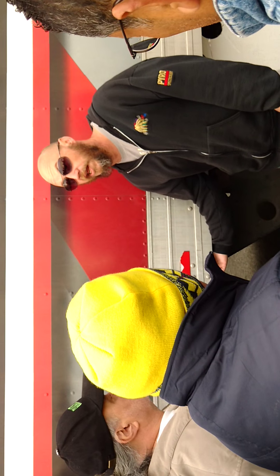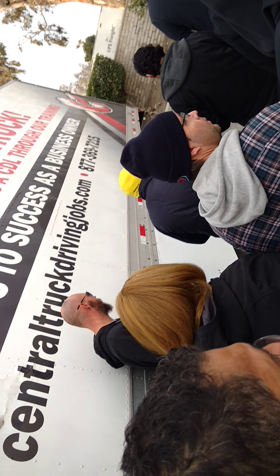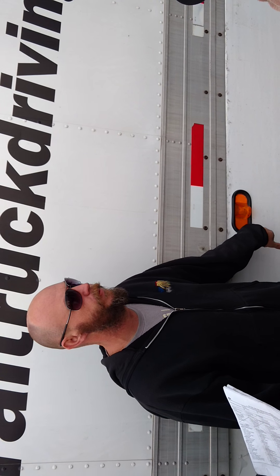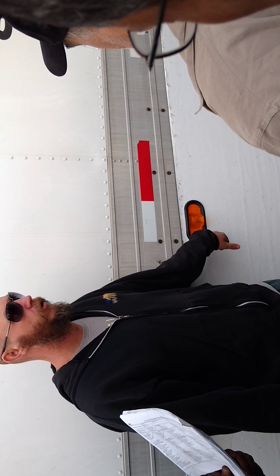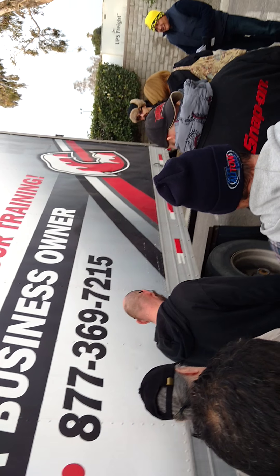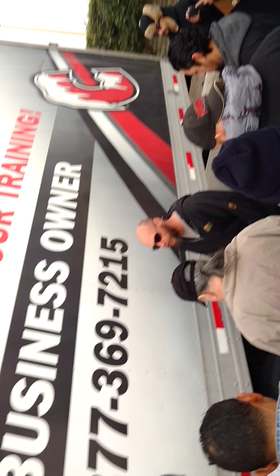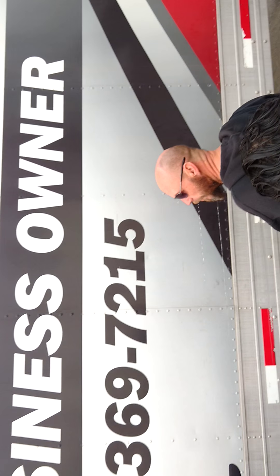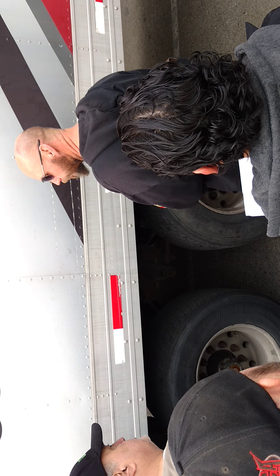Now you can come to the side of this truck and say: 'Mr. Examiner, I'm going to check the whole side of this — make sure I have all my lights and reflectors in good working order, they're amber in color, with left turn signal, right turn signal, and four-way flashers.' Side lights are always amber. The back is always red — by law, anything at the back of the vehicle needs to be red, because it indicates stopping. Mud flaps: the only specifics are that they cover the width of the tire, they're not hanging on the ground, and that you have them. Back here there are lights — I don't care about the reverse light, it's not on the test. These lights have five functions: tail lights, brake lights, left turn, right turn, and four-way flashers.